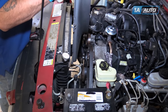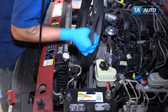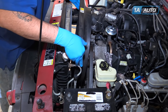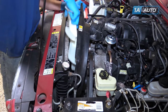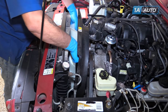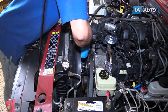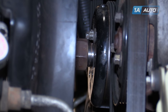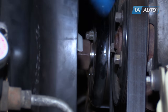We'll reinstall our fan shroud — a little tricky to sneak past the transmission lines. We'll lay our fan shroud back, sneak our fan in, and reinstall it onto the threads on our water pump. You may have to physically turn the nut for the first couple of threads. Once it's going, we can spin the entire fan assembly to get it on the rest of the way.